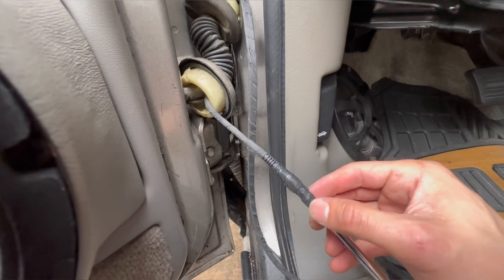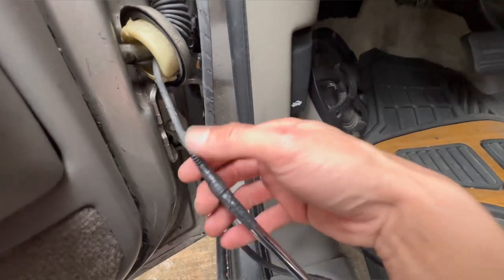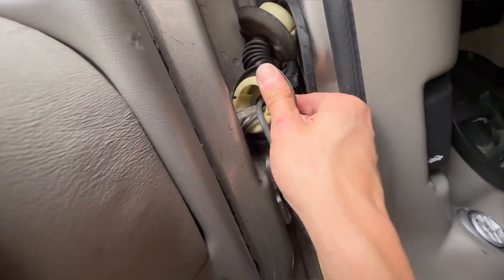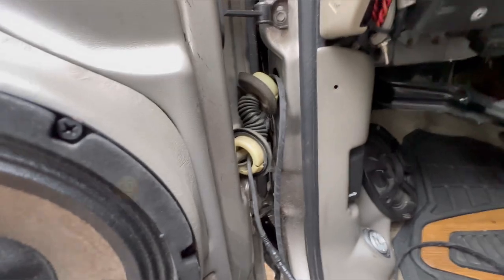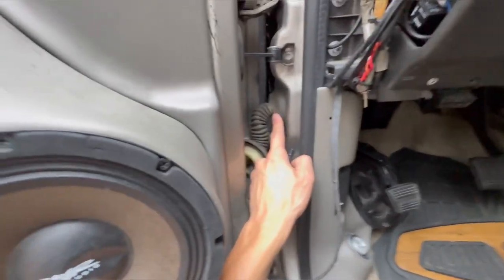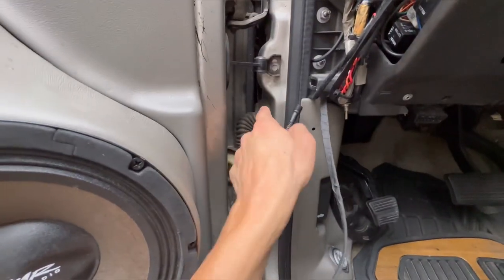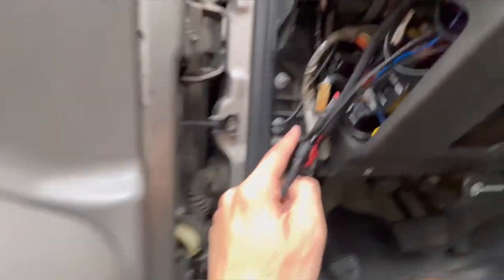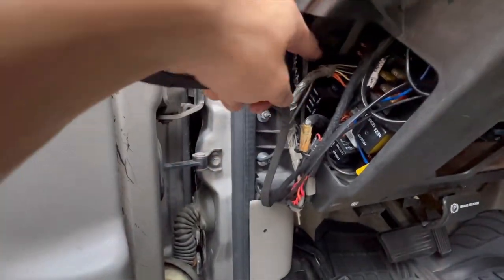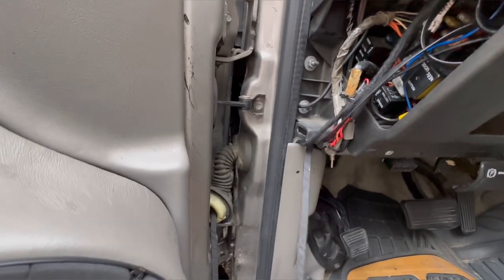Here I'm passing the five-foot extension with threaded connectors through the door boot, starting from the bottom, pushing the extension up and taping it from the top to pull it down. The wire ends up inside here, and the other connector comes up on this side — just like a plug and play if you need to remove the door or mirror, just like factory. Make sure you tape it up straight and flush — don't tape it on the side because it'll make it too bulky. There was already stock wiring and speaker wiring for my pods in there. Now that the wire passes through the grommet, it goes in the area where the original harness from the door runs, and I'll zip-tie it there so in case the door needs to be removed, it stays with the factory plug and they don't have to cut your wires.